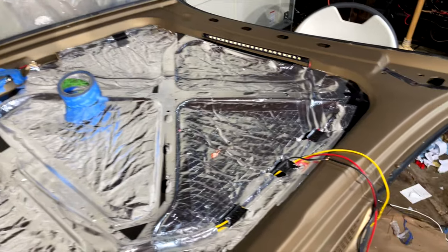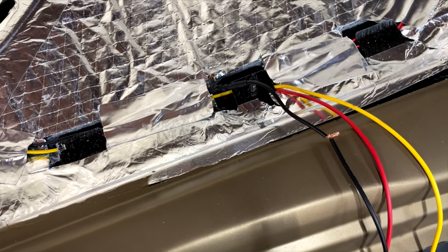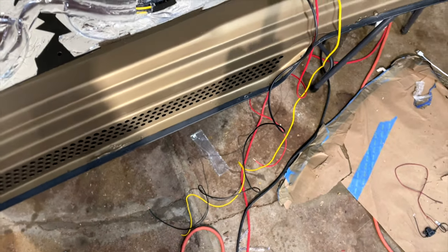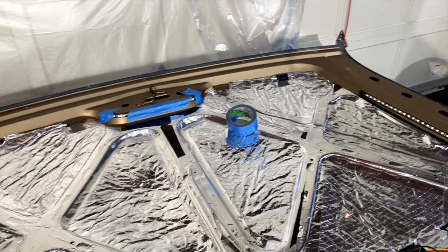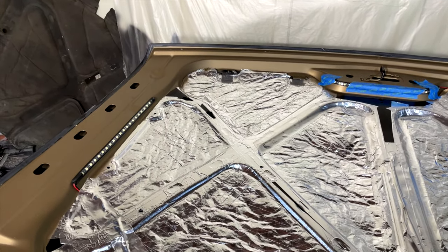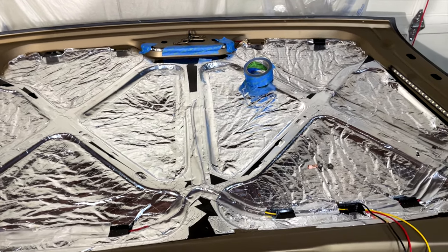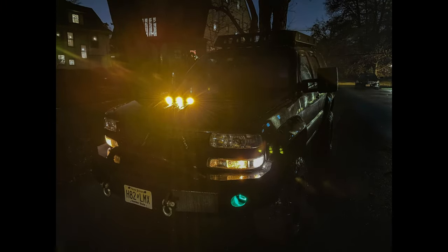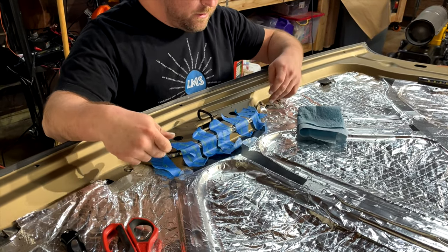You can see where I've done the wiring. I'm planning on grounding to the hood at that little post, and then I'll have two power cables: one for the under-hood lights connected to the hood switch, and one for the TRX-style lights on top of the hood connected to the daytime running lights. While I was in there I also installed three RAM TRX-style clearance lights in the hood intake — they are extremely bright; I might have to do something to bring that down.